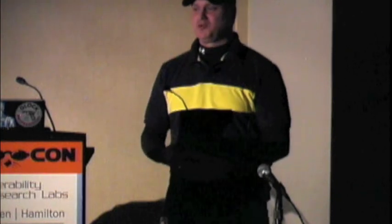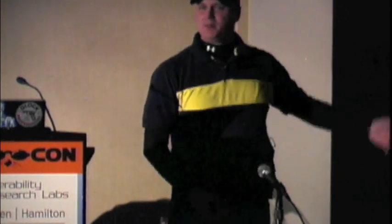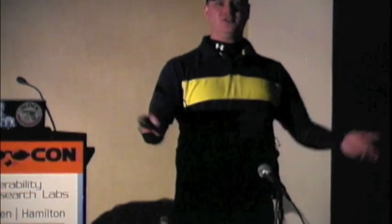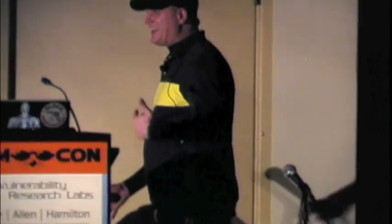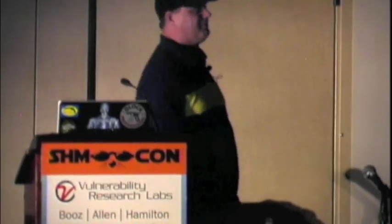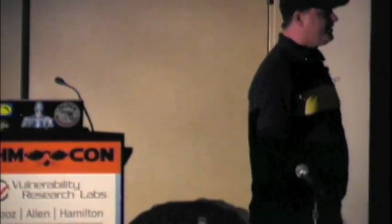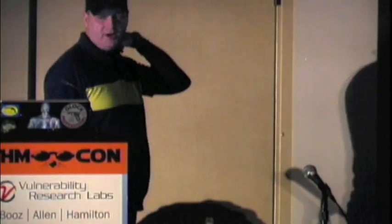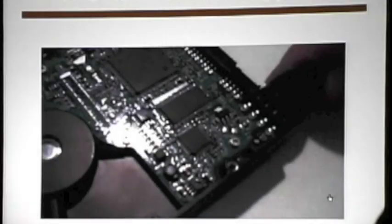Here's another thing. If you rip these off, don't plug it back into that power supply. That's probably the end of your drive. You will actually cause it, and it won't spin up again. Really, you just fried the damn thing. You're going to blow the preamp on the head assembly or something. So plug this into something else, okay? Get something a little bit better on your workbench to at least make sure that you can read this. But that's bad news.